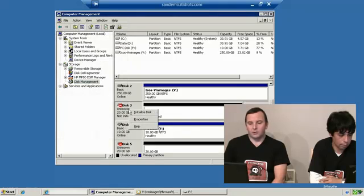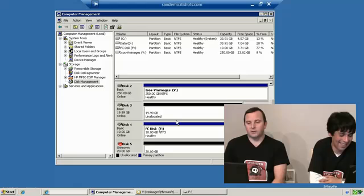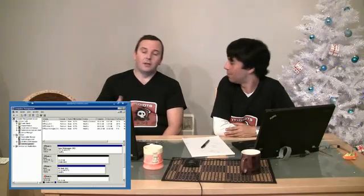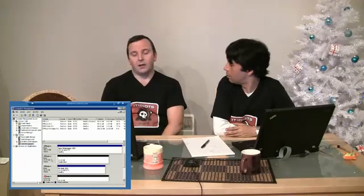We'll initialize one of the disks, which are effectively the same disk. Same for all intents and purposes. So it's probably worth explaining that, because when I first saw my SAN, that confused the hell out of me. I created a volume and I saw 4 of them. But what the hell's going on? If you see that, you know that the MPIO driver has not been installed. That's typically what it will be.